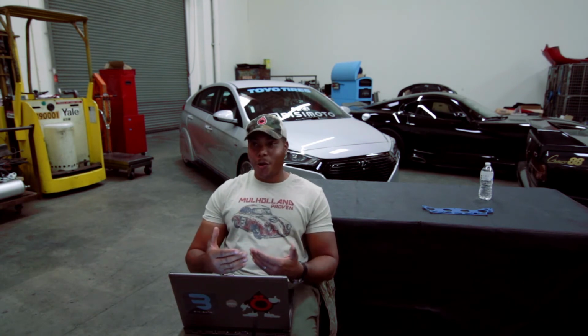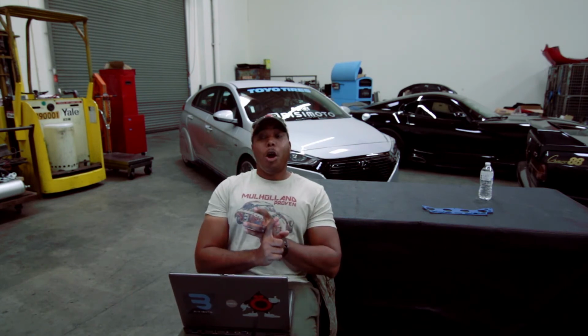So that being said, in the snow belt areas, or places where it snows, I would highly encourage you not to just run your engines when it's cold, because when the engine warms up and you throw hot oil on a cooler aluminum rod, it can break it. But you have pros and cons of every setup. I love the aluminum rods because of the weight. I love the cost-effective manner of choosing aluminum rods, because you can do a lot of R&D quickly and in a cost-effective manner that's cheaper than steel rods. They are shock absorbers, so they're very forgiving on the crankshaft and the rod bearings as well. And above and beyond that, it can act as a variable compression device, which is fantastic.